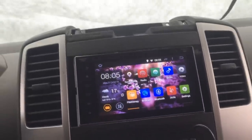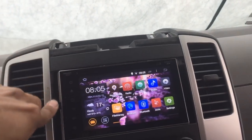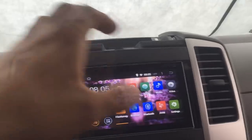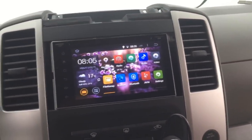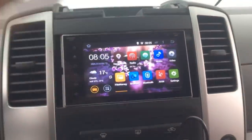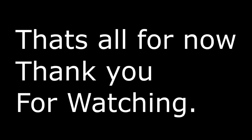We managed to take the dash, remove the factory stereo, and connect this unit. I know there is a gap but we're going to have to order a frame — one that fits right, but I'm pretty sure they have frames. There is still a lot to do: connect the microphone, connect a backup camera, connect an OBD scanner. There's still a little box in the store to deal with.